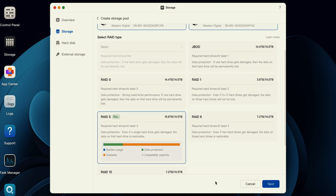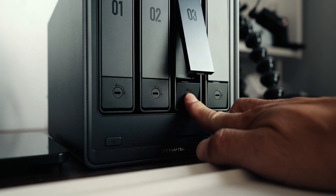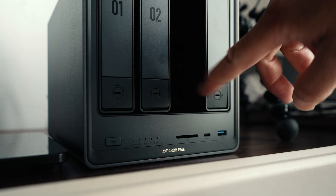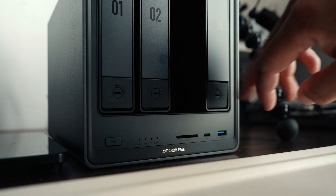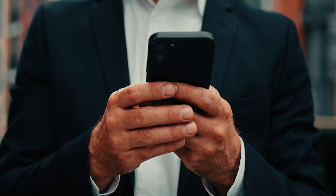What I love about this NAS is that it's super user-friendly — it walks you through the process even if you're not a networking or storage expert. The RAID configuration I'm going with is RAID 5, which keeps files safe using three drives to store data and one for redundancy. If one drive fails, it can be replaced and the system automatically rebuilds the data using the remaining drives — no file loss, no manual recovery, no downtime. Think of it like puzzle pieces: even if one piece is missing, you can figure out the picture from the remaining three. Once online, the NAS functions as a secure private cloud with full file ownership, accessible remotely from a phone, browser, desktop, or even smart TVs.